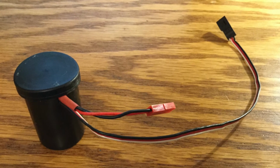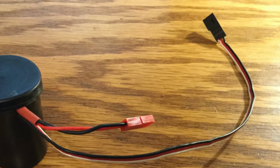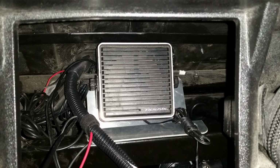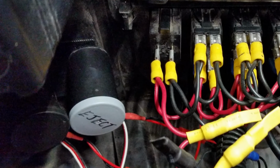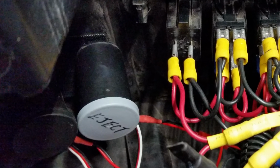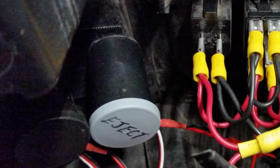Two sets of wires come out of each canister. A 12-volt power lead to connect to the appropriate switch, and speaker wires going to a speaker. You'll need one speaker for each sound card. I use Velcro to attach each canister to the back side of the dash. That way, I can just reach under the dash to pull out a canister if I want to reprogram it with a different audio clip.